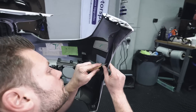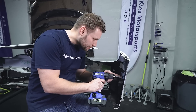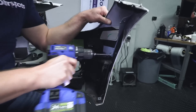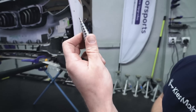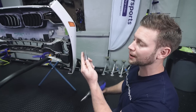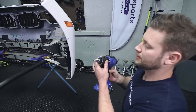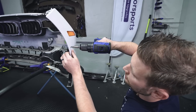For the stepped drill bit method, I like to first drill a pilot hole using a 3/16ths bit. With this method, we still need to go to 18 millimeters. I have three different options: one that goes from 4 to 22, or one that goes only to 18. What I really like about the one that stops at 18 is you can't go too far — with the larger one, if you go too far it's going to round the outside and it won't look good. So since this one stops at 18, we're going to use it. We'll drill from the outside in to make the cleanest hole possible.